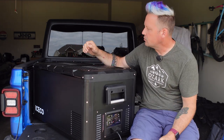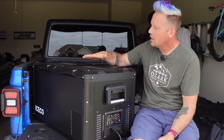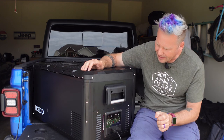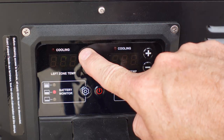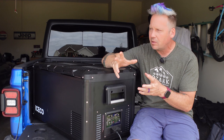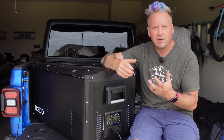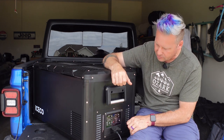Walking through the features: it's 75 liters, with a 45-liter compartment here and a 30-liter compartment here that loses some space because it sits over the compressor. The controls give you independent temperature controls for each compartment, plus an eco mode and a max mode. Max mode is for when you have this plugged into AC and need to cool it down really fast; eco is for when you're plugged into your rig running off 12-volt and want to maximize compressor efficiency.